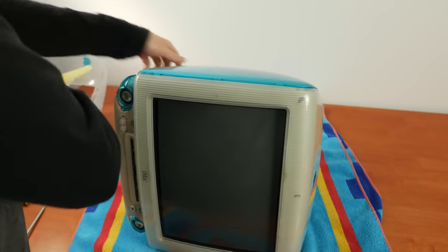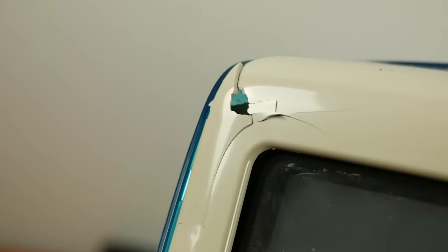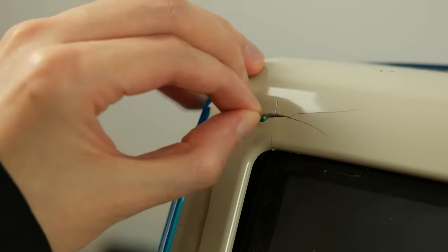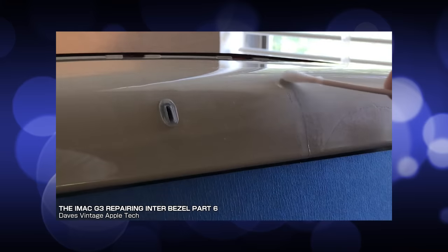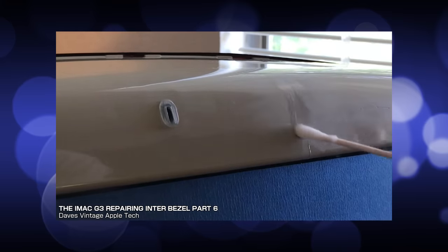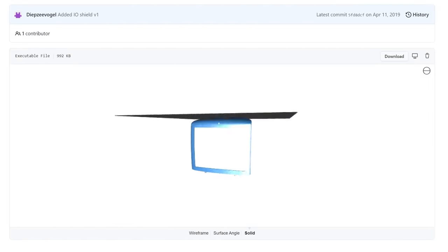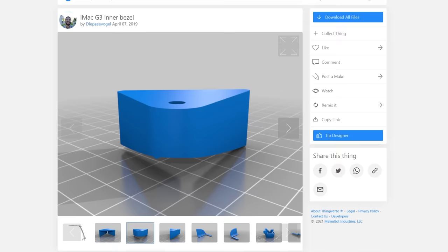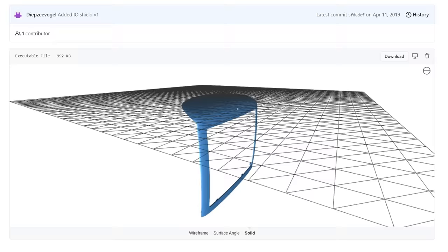Anyone who's dealt with these iMacs before knows that opening one is a monumental task in itself - iMacs being hard to open isn't such a new phenomenon after all. Eventually the case did pop off, giving us our first unobscured look at the inner bezel damage. It's pretty bad. I did some research and found it's an increasingly common problem - with age and probably some damage from UV radiation, this old plastic is just becoming brittle and fragile. I discovered a 3D printable model of the iMac G3's bezel. Apparently the creator was trying to do an LCD mod and the bezel just shattered, so he made this. Without the LCD mounting brackets, it looked pretty much like a drop-in replacement. What could be better than a brand new bezel?